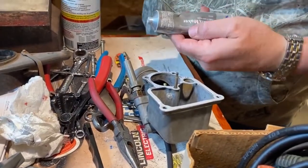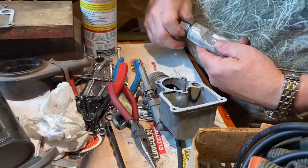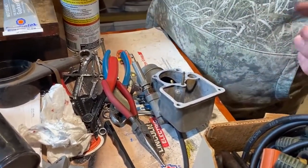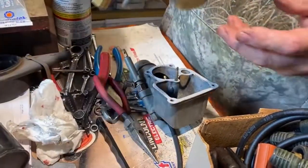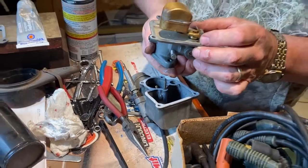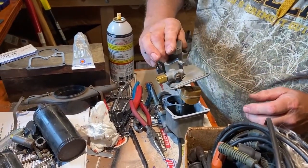A few weeks ago, we rebuilt our carburetor. We tested it out, and it did great. Upon talking with David Renner at Renner's Corners Early Fords, he suggested that once we were satisfied with how it was performing, we should apply some gasket maker to the carb in addition to our new gaskets to help prevent any leaking.